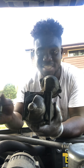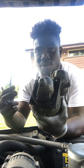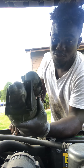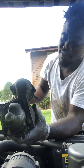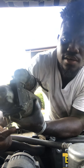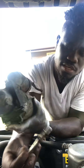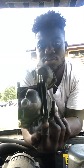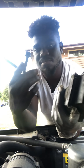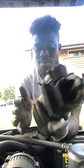This is the main part. If you already know how to change the starter and just want to do the diagnosis, go ahead and end the video — but don't forget to subscribe before you leave. For those who can't take it out, I'm going to show you. When you lay down under the truck you see it hanging there. There's a screw here and one here — I think it's 13 millimeters. You take both of them out and pop it loose.